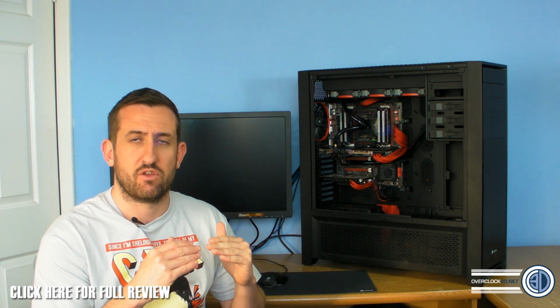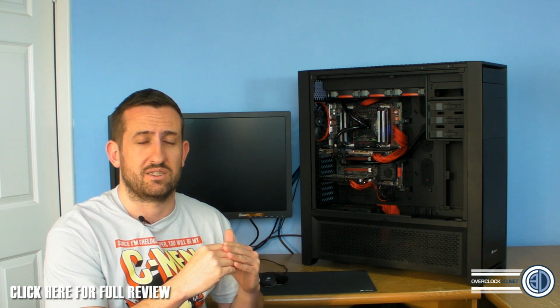Admittedly, we had the fan at 100% to get those results, but like I said, the eagle-eyed amongst you may be then thinking, well, why couldn't you overclock it further? Well, I didn't push the volts beyond the NVIDIA limits. You can overclock, push the volts past that point should you want, and I didn't do that. So the thing that we can take from that is yes, okay, we needed to have fans on 100% to be able to get those, but it wasn't necessarily a heat issue that was stopping our overclocks previous. It was a voltage or card performance issue, as in the silicon lottery.